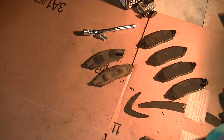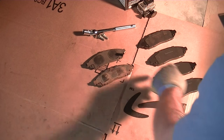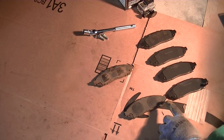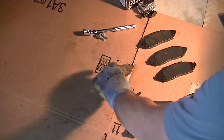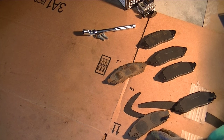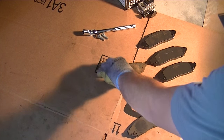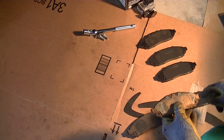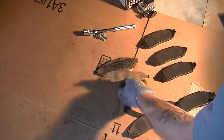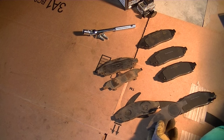While that dries, let's talk about the pads themselves. The pads all look very similar but there are a few differences. This one has a tab, and the one I just pulled off the car — the inside pad — has that same tab, so obviously those two go together. The rest are pretty much the same. Also, the pads on the vehicle had actual pieces of hardware on them — each one has a shim, and one has additional hardware pieces. Just peel those off with your finger and put them on the new replacement pads.